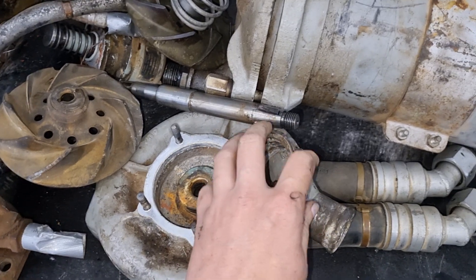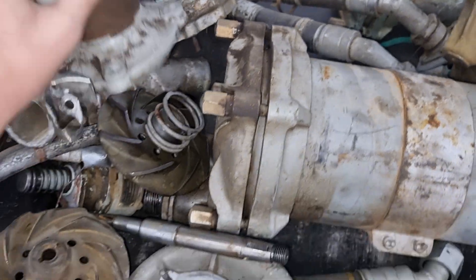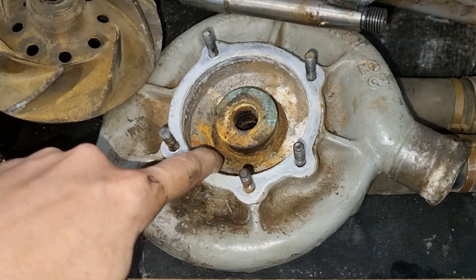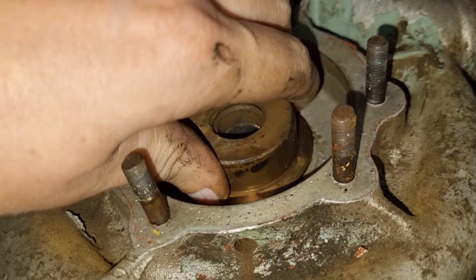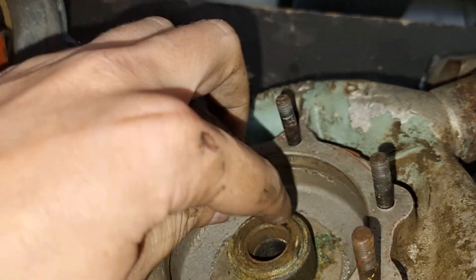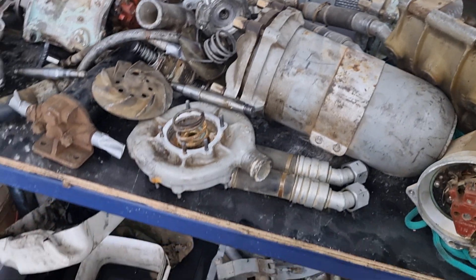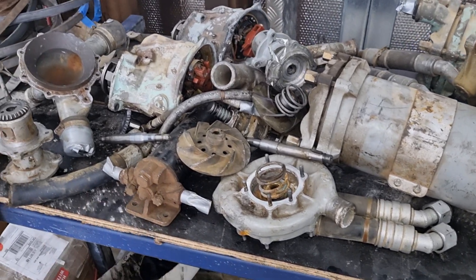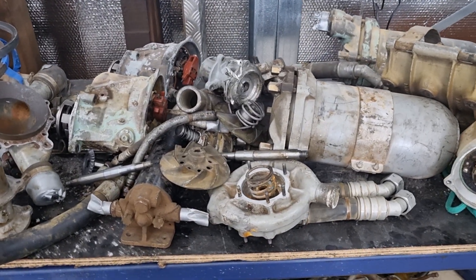There is also just a spring. When it's all assembled — back over here — when that sits on top of there, it actually compresses the seal into it. This should be a machined, nice, clean surface — not completely unlike this one. You can see the surface there. Basically, it should look like that on both sides all the way through. This one's cactus, so no go for usage. So there you go — a quick little explanation on how the water pumps work and when they don't.